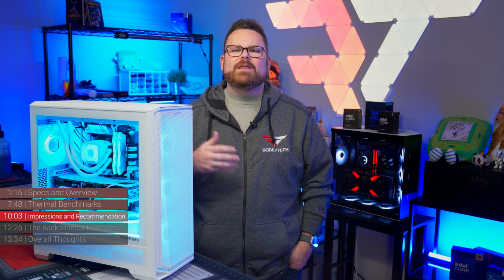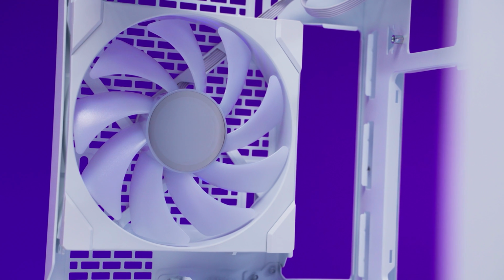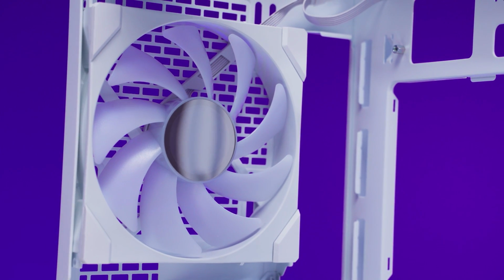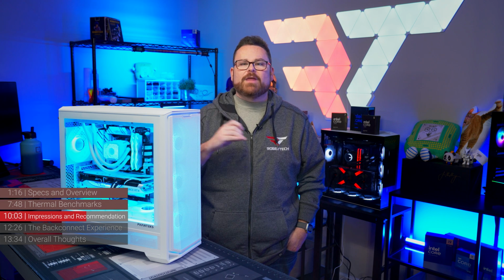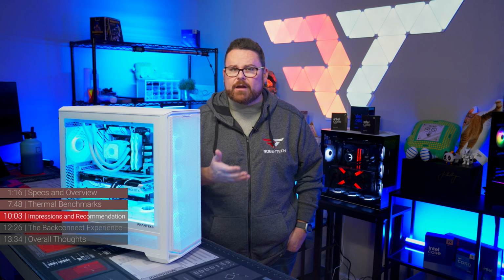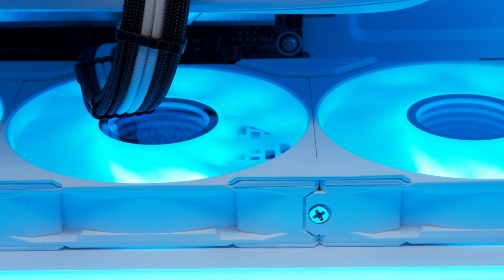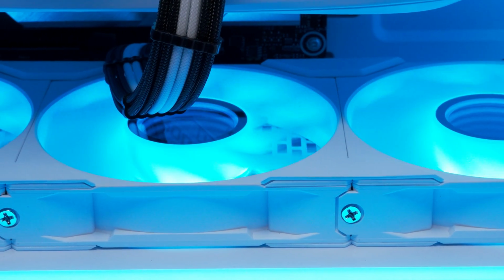And if you're planning on keeping that rear fan installed, we'll have to sit at the lowest possible position, and you'll need to run your AIO hoses to the back of the case. This is also where you need to be careful with AIOs that have slightly longer radiators or more pronounced hose bump out.